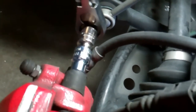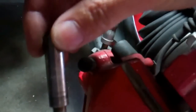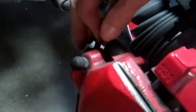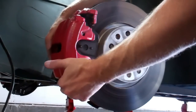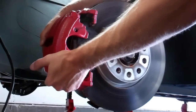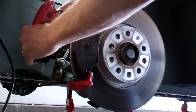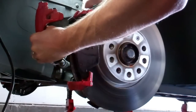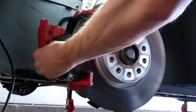Let's break both the caliper bolts loose now. These are kind of like pins which the caliper slides on. You can see here they're like that and you've got your Allen right there. So I got these two loose — let's take off the caliper. The inward pad is in the caliper when you get it. The outer one here just falls out so I'll take that one out of the way for now.